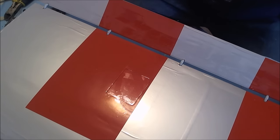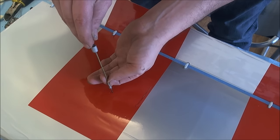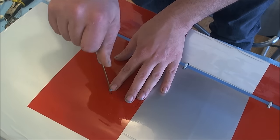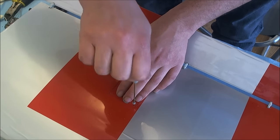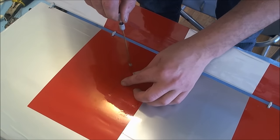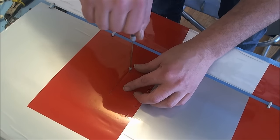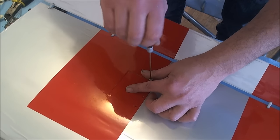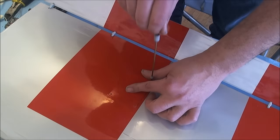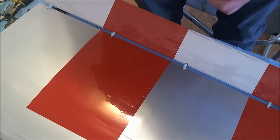One thing I found that helps is if we get our little drill or center finder and poke these holes through the cover. Go ahead and get them enlarged. Just a little tip to make life a little bit easier. Now don't drill through the mounting block. You want that to fit good and tight. Just through the cover. And once we get this done, all you have to do is adjust your clevis to get your flap in the neutral position.